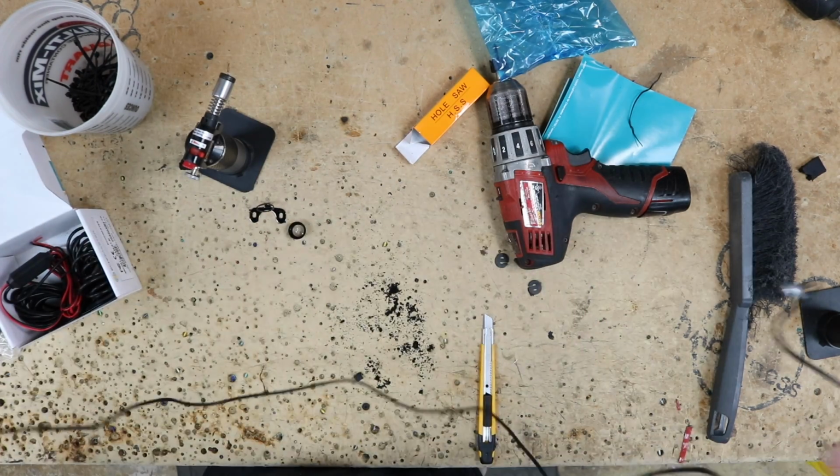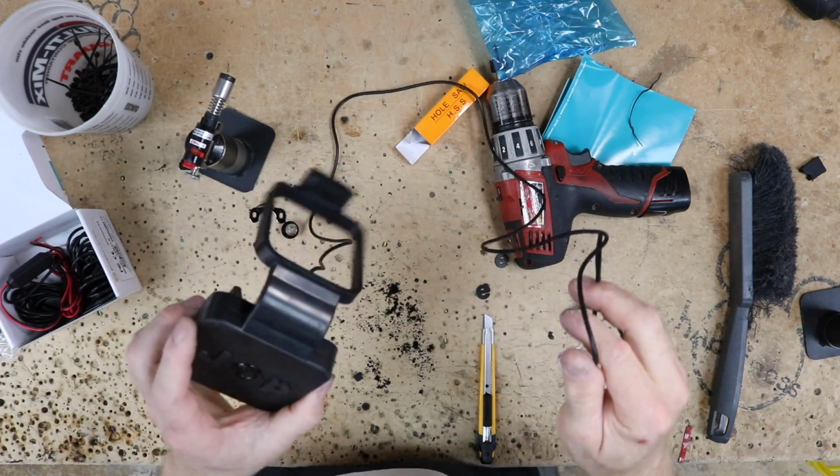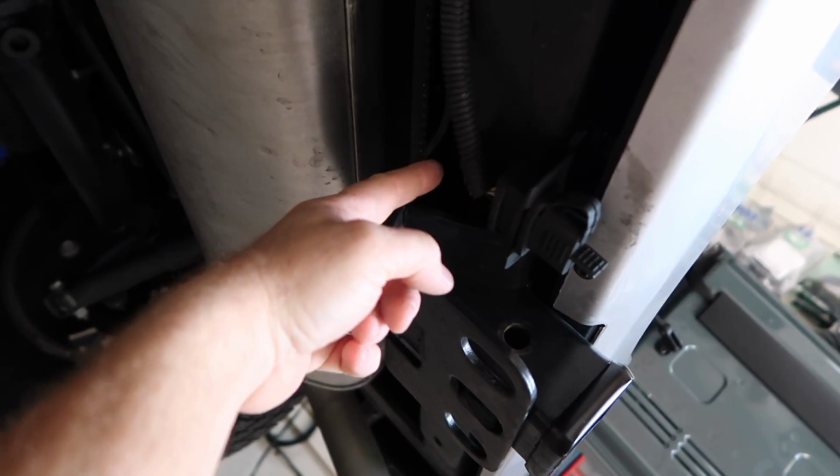Now what we need to do, the real key, is prepping this cable. And let me go show you why the prep is the most important. We've actually changed the way we've done the prep on this because of one guy. So what we've been doing in the past is loom, 2 layers of tape, and making sure that it stays away from this guy right here, the exhaust, so it comes out of this, this, and then it goes up into the car.